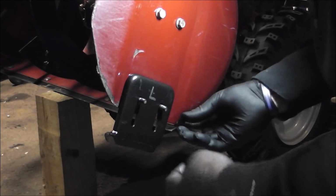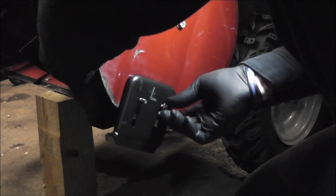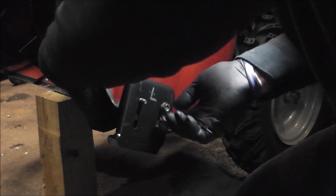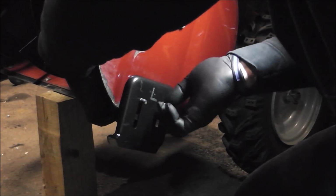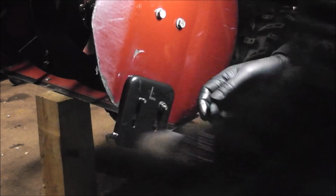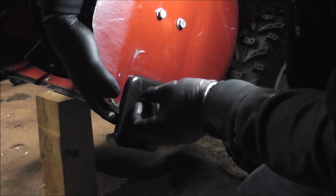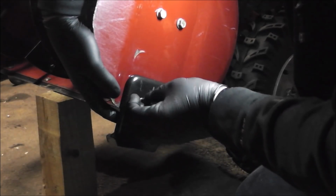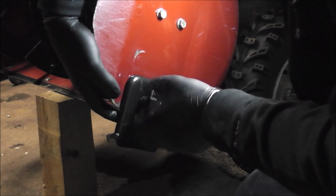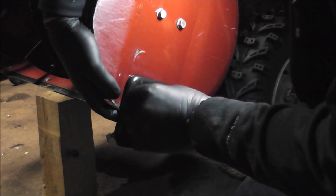They make two types of Loctite. They make a red and they make a blue. And the red, you actually need heat. You got to apply heat to it to get it apart. The blue, you don't. So that's kind of how I remember it. Red, hot, is in heat, and then the blue Loctite kind of is in cold, meaning cool, and you don't need heat to remove the blue Loctite.